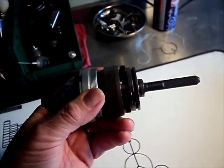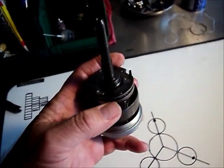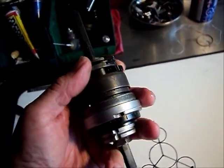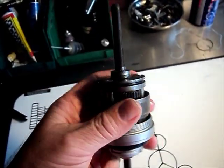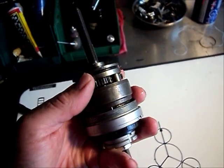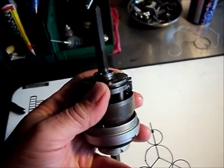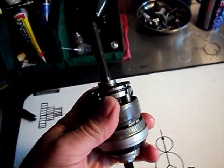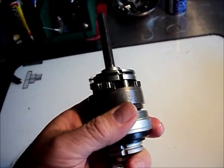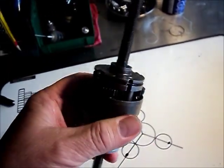The newer design five-speed wide-range model has been changed somewhat so that the planet cage is a complete sub-assembly that includes the sun gear. When you take the planetary cage off of it, the sun gear is actually part of the sub-assembly, which means you don't need to concern yourself with the timing. A lot of the new design gear hubs are designed so that everything is made in a non-serviceable sub-assembly, so you don't have to concern yourself with the newer hubs.